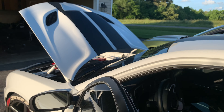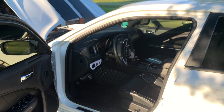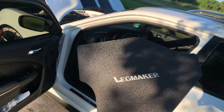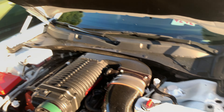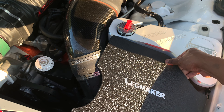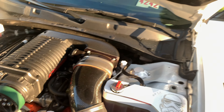I did call Whipple and Whipple wanted a ton of money for their shroud. The car's missing a shroud — I took it to the dealership, had some stuff done, and they lost the shroud. So I ended up buying one for about a hundred dollars from the aftermarket. I'm going to have to make the notch bigger so that it'll fit. Once I make the notch bigger it should easily just go on — right now it's hitting there. It could work like that but I don't want water rolling onto the filter, so I'm going to notch it.